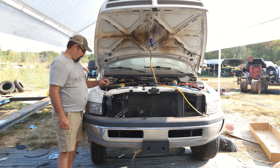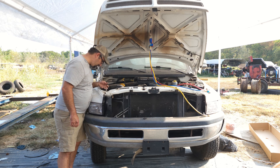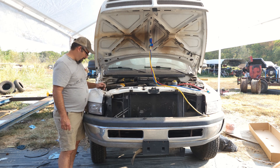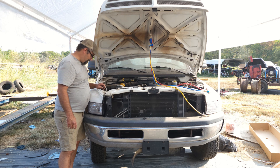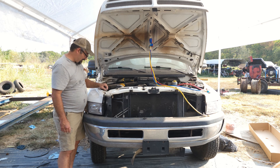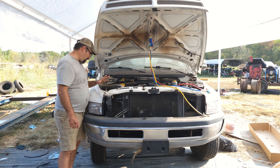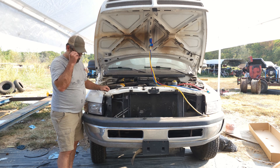This liquid line up here — this valve — has fallen completely apart. It's just trash inside. I don't know how it happened; maybe whoever tried to refill this last did something bad. We need to replace the whole thing because this is brazed on, so it's not something I can easily just swap. Luckily you can actually pick these up at O'Reilly's — 50 bucks, in stock. Kind of surprised me.